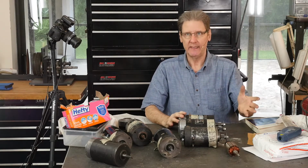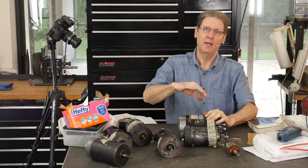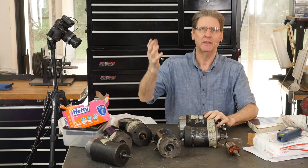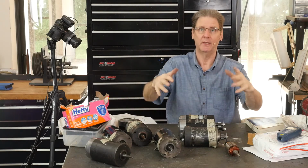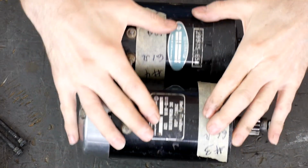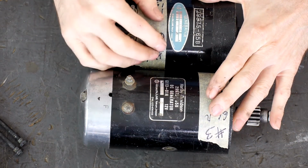It was 1982, 83, and the beginning of 84 on Sportsters. Then late 84, they switched to an alternator under the clutch, and I don't like that buried under the primary stuff, so I'm just sticking to generators. Here's the two different labels. The Skycam will show you. I'm not sure which was first and which was second.